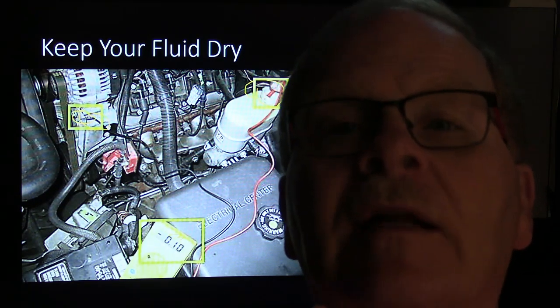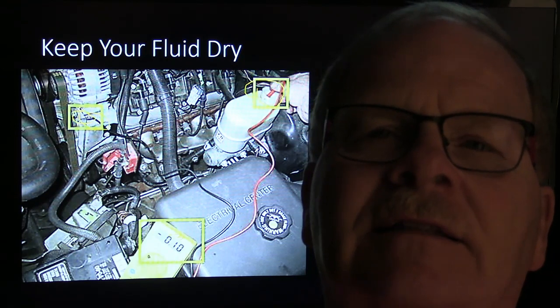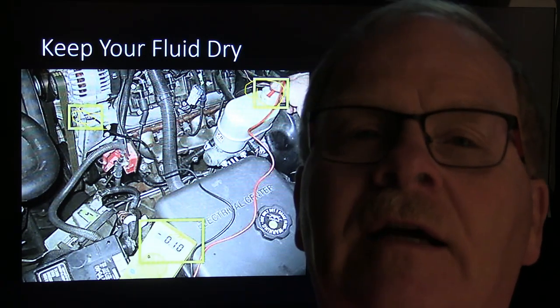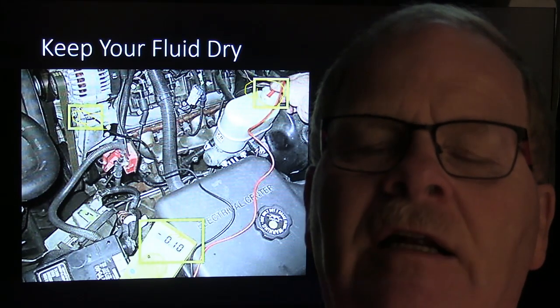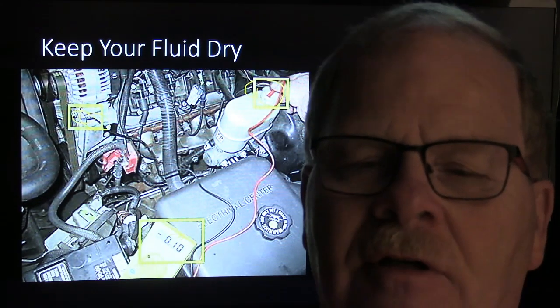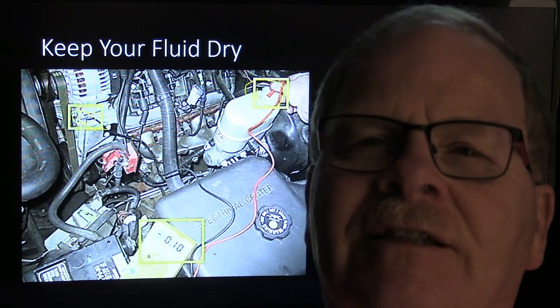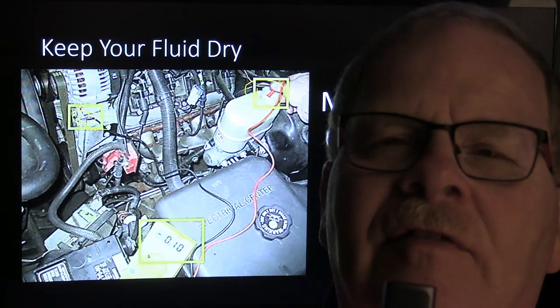You've got to remember, when you're bleeding brakes, you may have a big air bubble that's working its way through the system, and you're still squeezing that, even though you've got clear fluid coming out of the bleeder. Also, you can bleed the brakes without the engine running, and the pedal may feel just fine, and then whenever you fire up the vehicle, that extra brake booster action will make the pedal go too low. So you'll know by the pedal travel if it feels right.